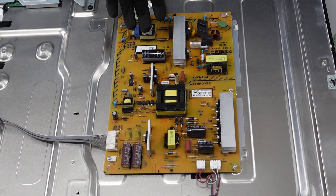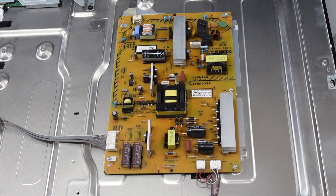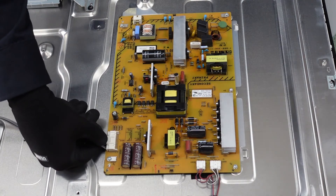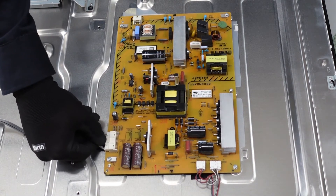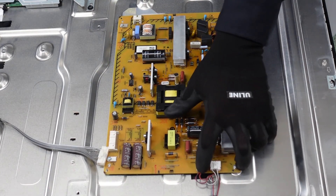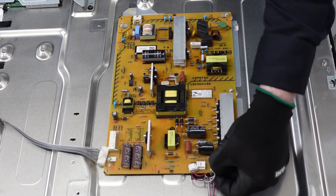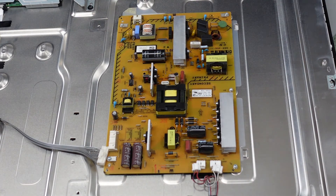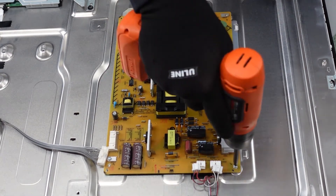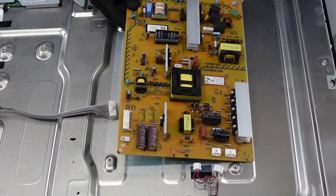And lastly, here we have the power supply board. There are just about three clips here, here, and here that we need to get removed from the board before we can safely unscrew and remove it. This one here, we're going to push down on this latch with our thumbnail and slowly walk it away from the board — it comes right out. Both of these are going to be the same style; there are little latches, you push down and they just pop right out. Now that we've got those unplugged, we can remove the screws and this board should come away from the chassis. After we take those screws out, we should just be able to lift this away, no problem. And that's the power supply board.